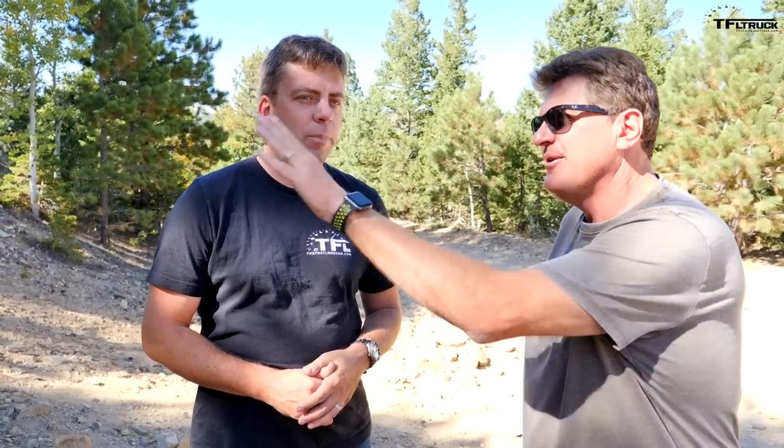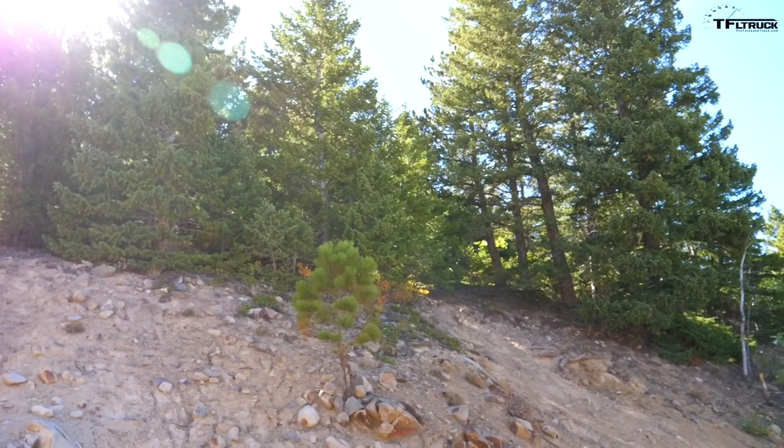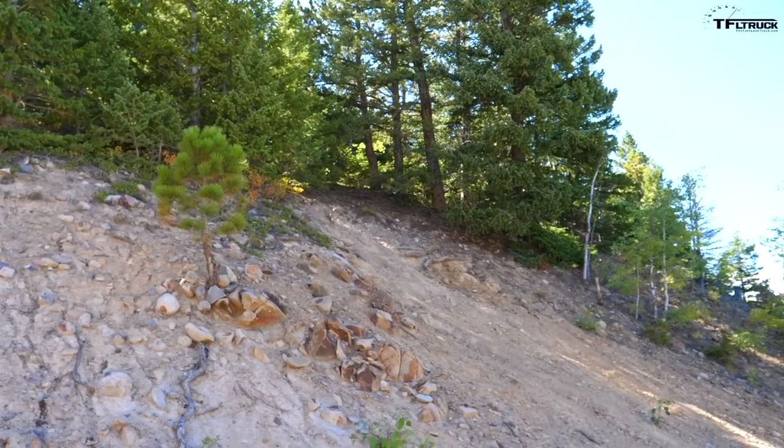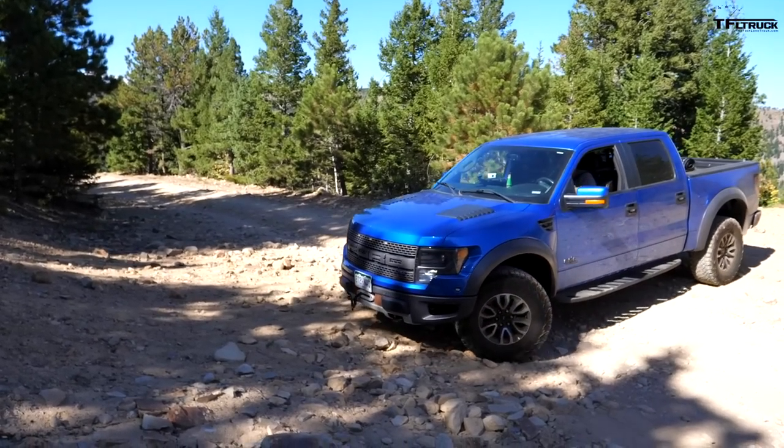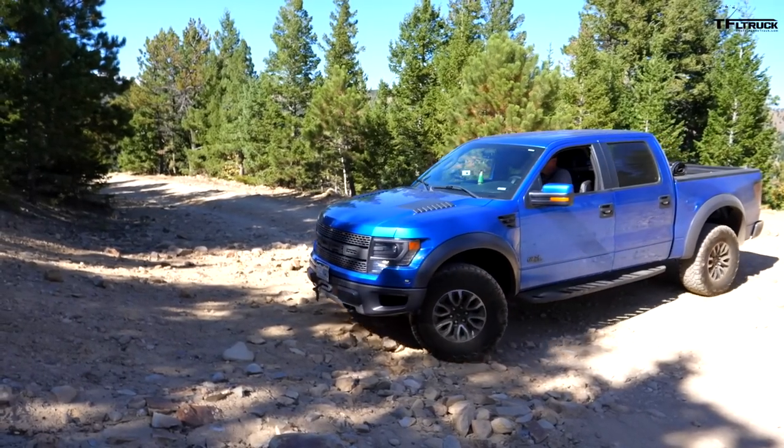How about this, Andre — granted I'm a little concerned about the truck — how about we go up this hill, it's pretty steep, and see how high we get with the rear diff not locked, and then lock it and see if we can get higher? Attempt number three to show what a locking differential can do off-road. This time we're going to go up this very steep hill and see how far I get before I start losing traction, then lock the rear diff and do it again.